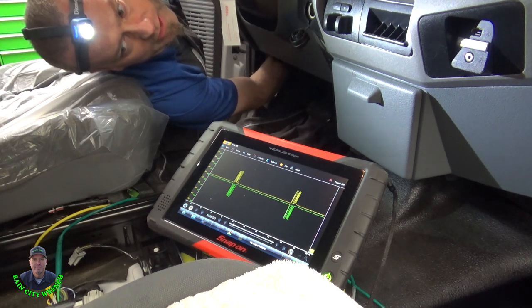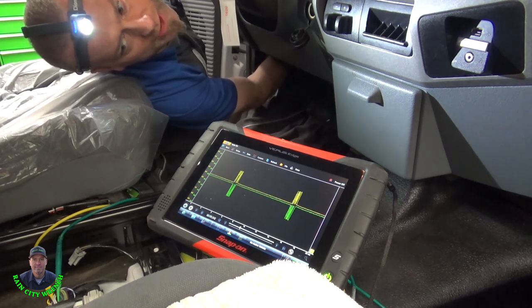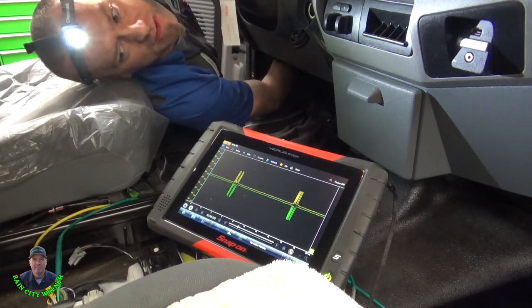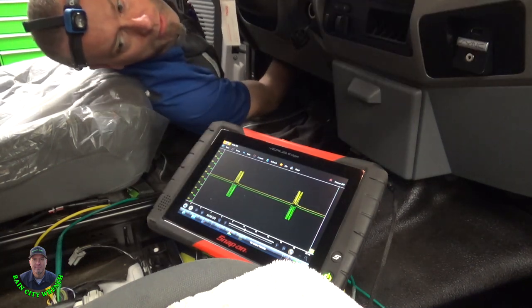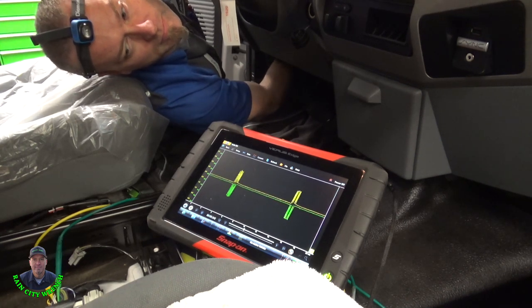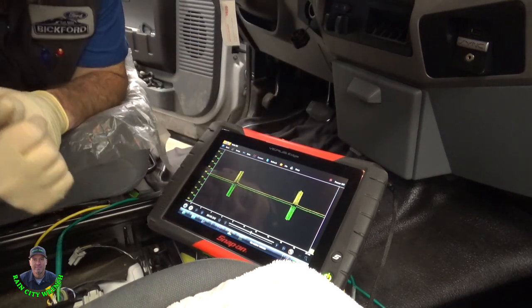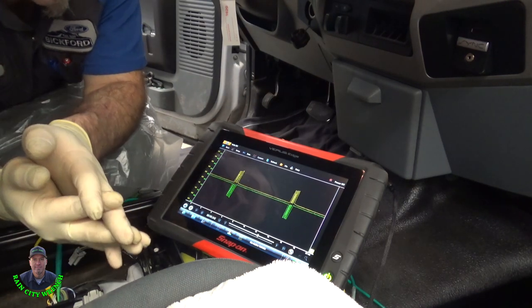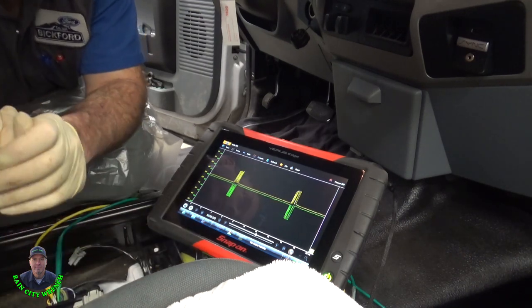Kind of pulling out on the connector — now I've got it. I think I pulled on it so hard I've actually got it to where it won't flake out now. That's what it is. So I need to get in there and see if I can clean it up and do a drag test on it, or else I'm going to have to just cut the wires and overlay it to bypass that connector.